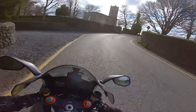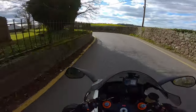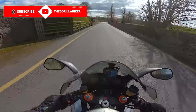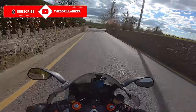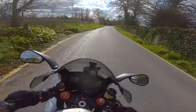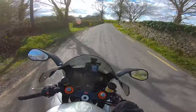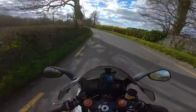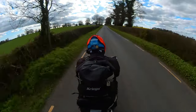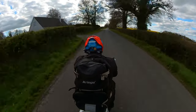One thing I actually forgot that I'll add in here. Is there anything that I don't like about the bike? Well, like I said, in the video where I said the bike tried to kill me, that oil line that popped off because of pressure, I do think that's a bit of a design flaw. I think that's a poor failure mode that, to be honest, shouldn't be left in. Obviously it's not there anymore, but it's something that should have been caught in the factory by Rotax or by Aprilia: if your vent did get blocked, the engine's default was to blow off the oil line and drench your back wheel in oil. That's not a good failure mode, and I don't like that that's still there.